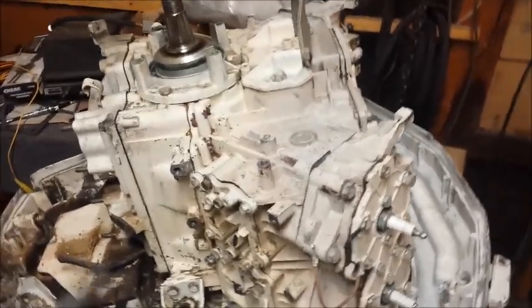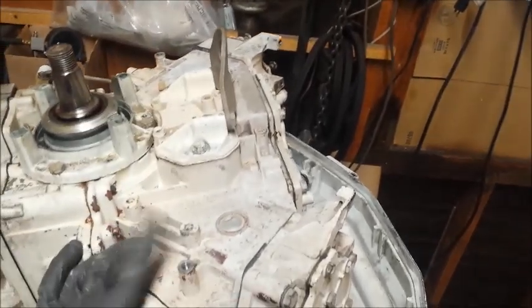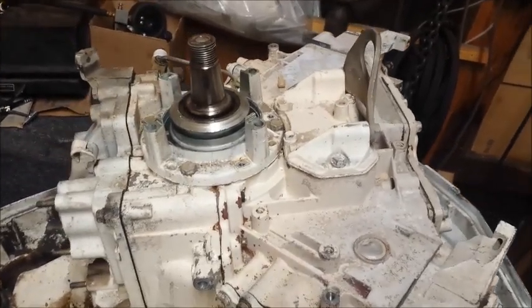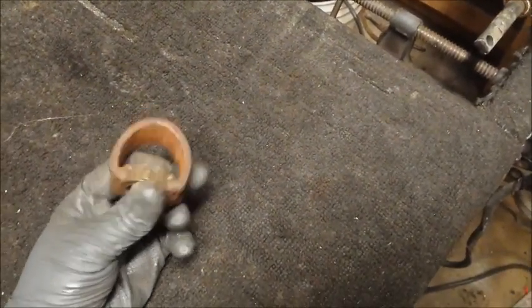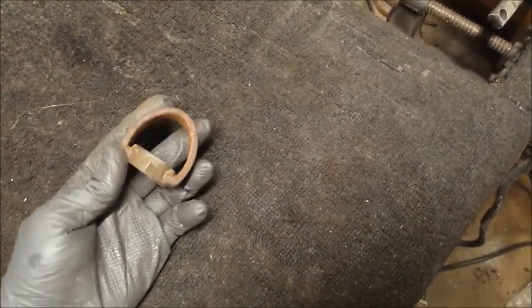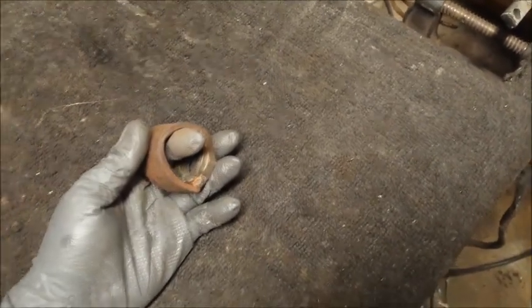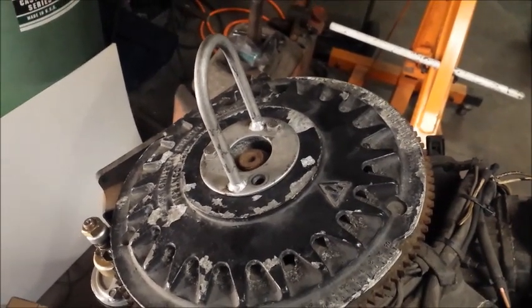What you want to do is pull this thing straight up. You don't want to attach it to just a hook and pull it up because of any studs that are still in there — they're going to bend and break. You just might run into some problems with bent studs. So I'm going to use this tool — it's a flywheel nut with a little hook welded to it, came off some junky engine I picked up. You don't want to make one of these since the flywheel nut is about 20 bucks — kind of silly. But I'll show you the tool you should use: this is an engine lifting tool that bolts right onto the flywheel so you can pull it off complete.